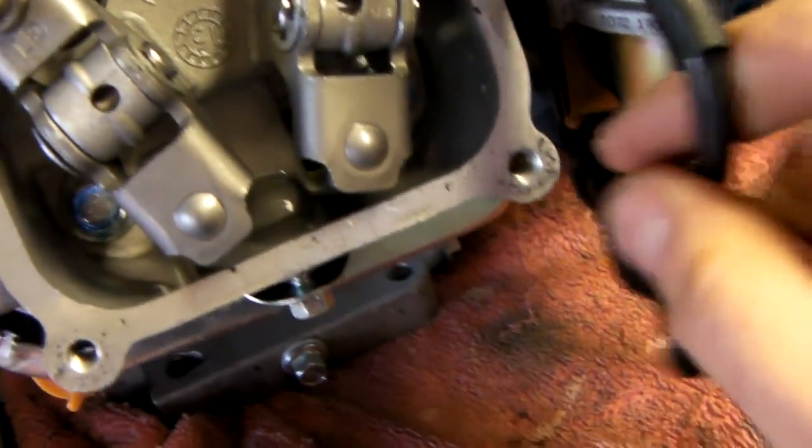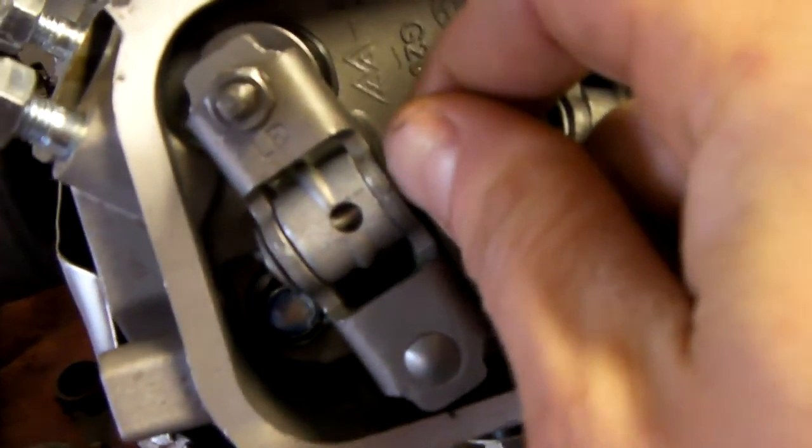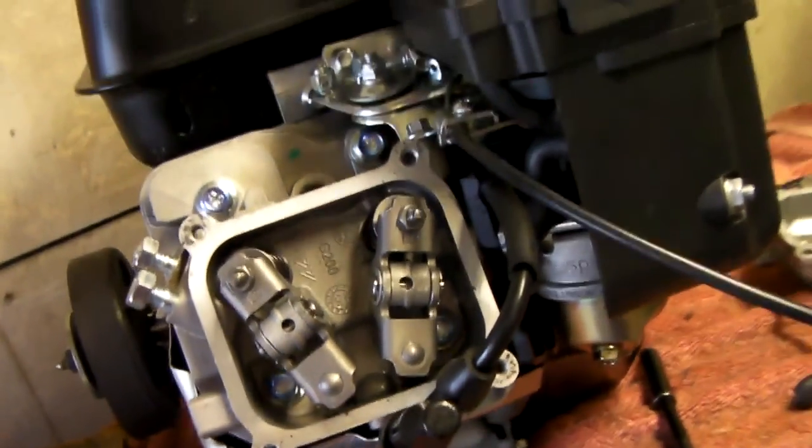Like I said, it's a little different — I've never really done them on this kind of style motor so I guess I'm gonna learn something new today. What I'm gathering is I've got to pop this C-clip out and slide the whole thing out, and that should allow me to lift the whole rocker right out. And in that case I won't even really have to touch the valve lash, but that's not always the case — I'm just saying it could be.